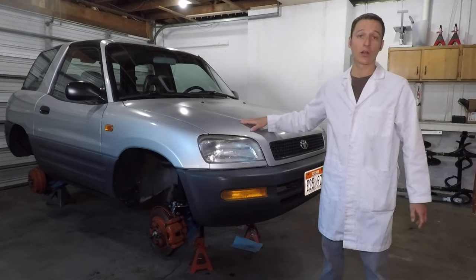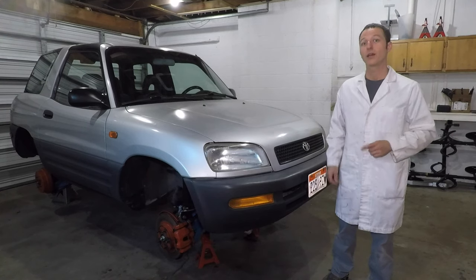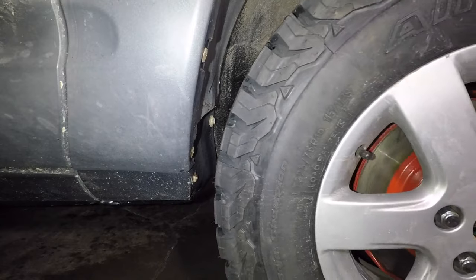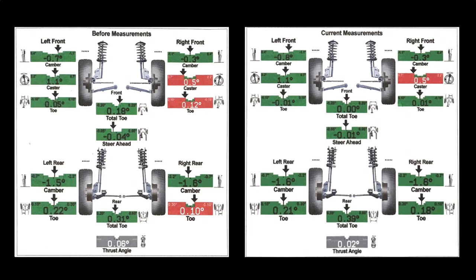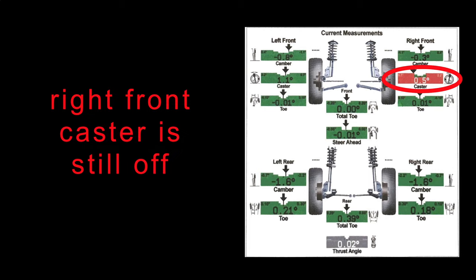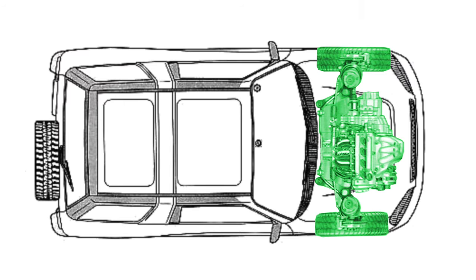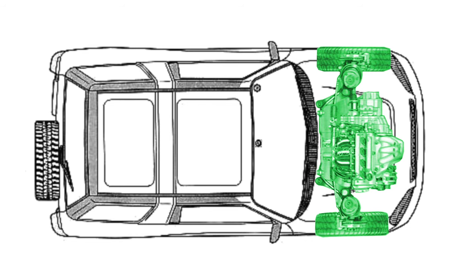I've cleaned the bolts and this car is good. All I have left to do is take the car into the shop for an alignment. But first, I'm going to try to realign the subframe. In my tire upgrade video, I had problems with the right front tire touching the back part of the wheel well. Alignment numbers confirmed this and showed my right front caster was too far negative. That means the wheel is too far back relative to the top of the strut. I'm guessing the subframe might have moved. Right now I'm going to try to move the subframe and hopefully fix that negative caster.